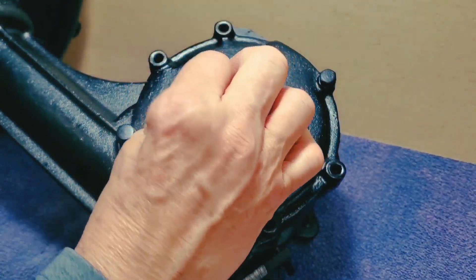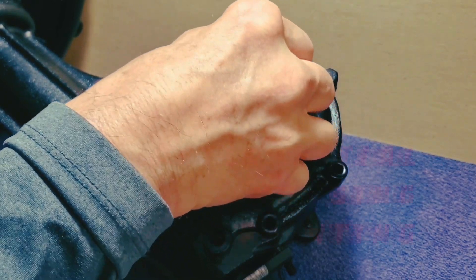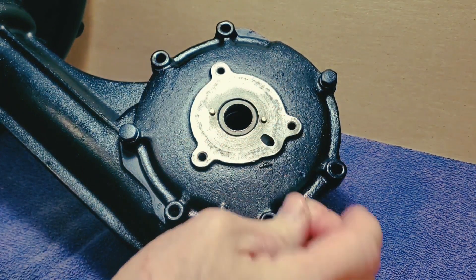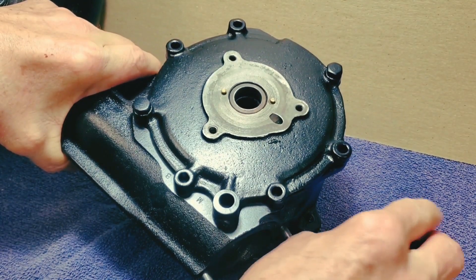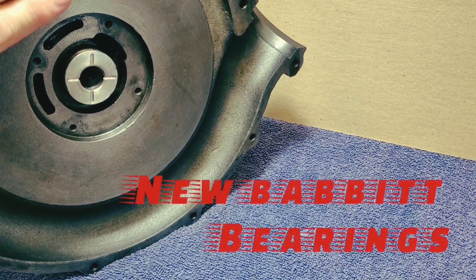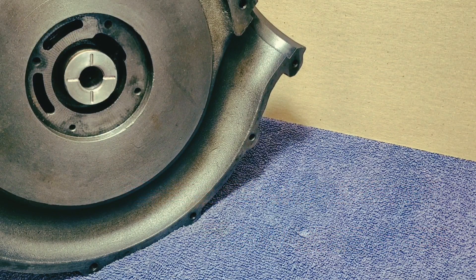You can see we're taking off tape — we've installed some of the parts on the supercharger temporarily so we can paint the main supercharger housing. In a moment you'll see why, because we sent this one out to be completely rebabbitted. The bearings were completely shot to the extent that we had to redo them, and of course the shaft was bad — everything had to be undersized. There's the new babbitt in the supercharger.